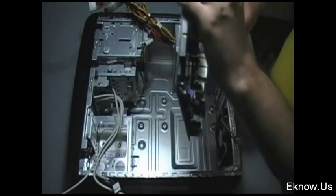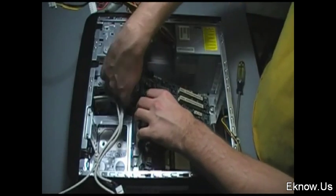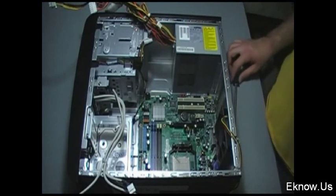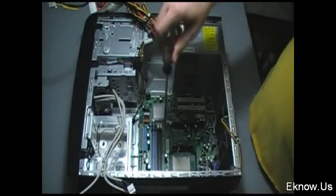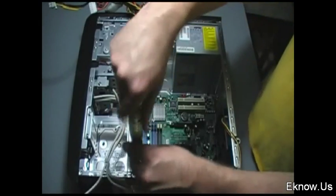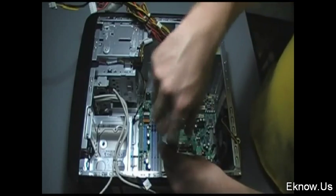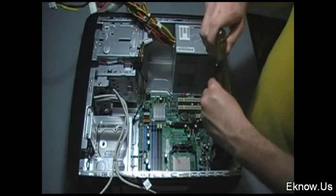This piece right here is your motherboard. You see me sliding the back end into place first and then dropping the front end down. Make sure all your wires are out of the way, then lower it down. There are holes cut in the back of your computer case and corresponding pieces on your motherboard — line those up and slide it back. All your screw holes should then line up and you just screw it in. I've been fast-forwarding here because there are about 10 screws. You want to use a long-handled screwdriver, and one with a weak magnetic tip helps since screws can fall onto the motherboard.